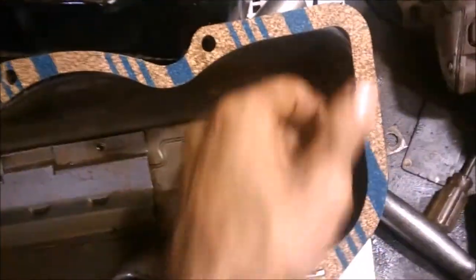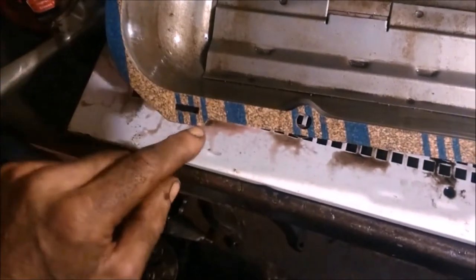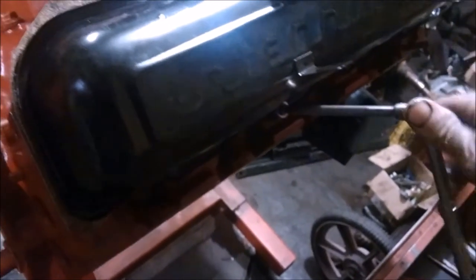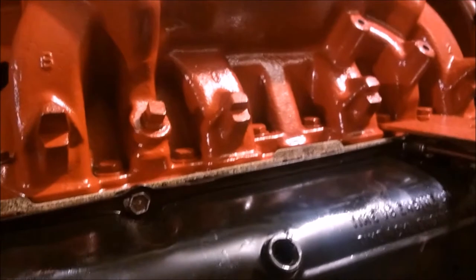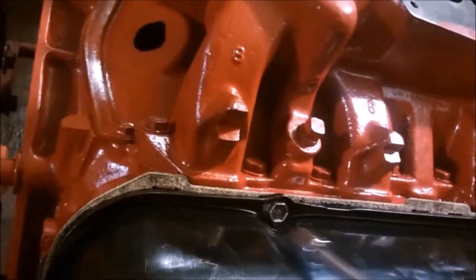An ultra-fine layer of black silicone, slap our gasket on, get everything in place so it holds, and install this valve cover — we straightened it first just like our tappet cover. These little slots go right in here. As you can see, that also makes installation — not only removal — easy. It's a light two-fingered-and-thumb feel, not even to the end of the wrench. You're not looking for thread stretch here — you're going to destroy the gasket and flex the pan long before you stretch that thread. That's why we had to straighten these pans and covers out: someone over-tightened. Cork gaskets will swell.